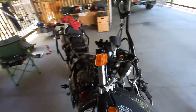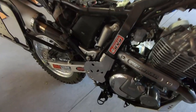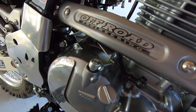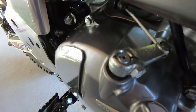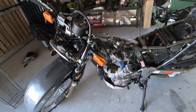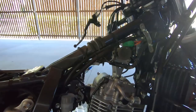Poor old doctor — he's in bad shape. Now the tricky part is the clutch cable — not enough stretch with all the cables loosened and everything. So I'm going to disconnect this here to give me more room, but first I need to mark the position with a sharpie. That should do. Right, I can undo this and take this off and I should have some more room. That's one side off — taking that off enabled me to loosen the clutch and I was able to slide that off.